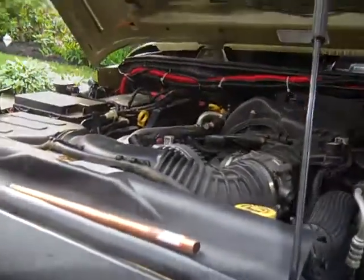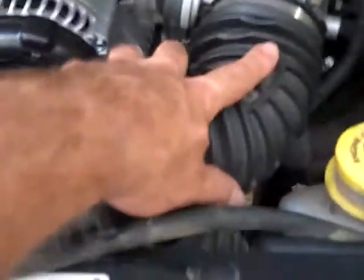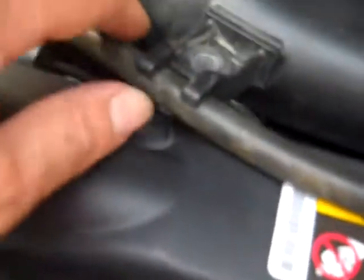I'll kill the engine and show you what's making that noise. To get access to the engine compartment, you'll notice I've already taken off my engine shroud cover — that just pulls right off. Using an 8mm socket, I loosened the brackets on my hose intake, and with a 10mm I took out the bolts. We'll pull the cooling hoses out of the way and pull this off the air box, being gentle because there's a sensor wire connected here — we just fold that over and get it out of the way.